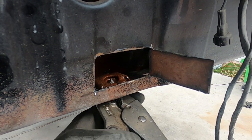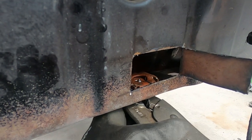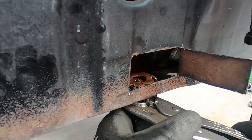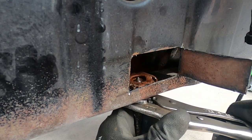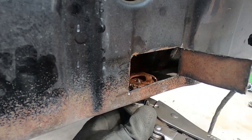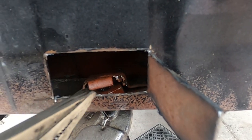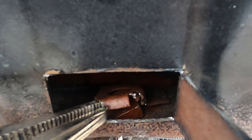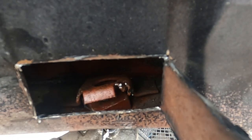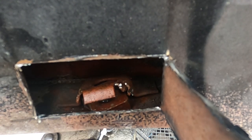This thing's going to be hard to break loose. It just broke free out of the pocket again because that bolt is just seized in there. Let's try some heat. I went ahead and pried this little clamshell up, and I'm going to try to use my other vice grips to hold the nut while I turn on the bottom side and see if we can get that thing to come out.